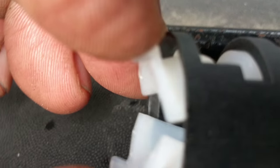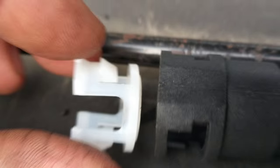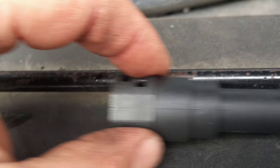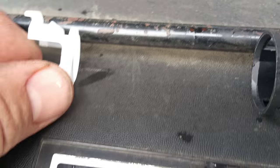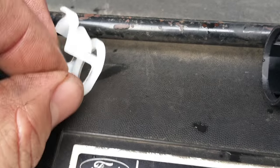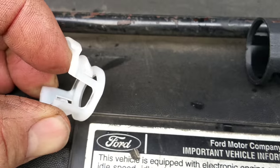Just give me a moment here, I'll try to do this with one hand. When they separate, this will stay on the pipe right here. This will stay on the pipe, and this black assembly will separate with the hose away from the nipple on the heater core. Now you can go in and separate, open up the white clip just like this, and pull it off the pipe.